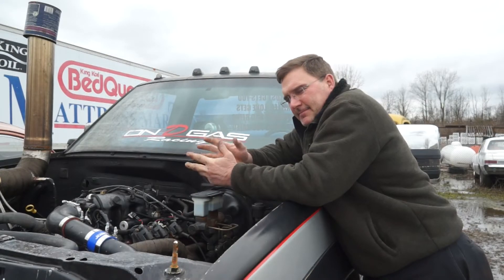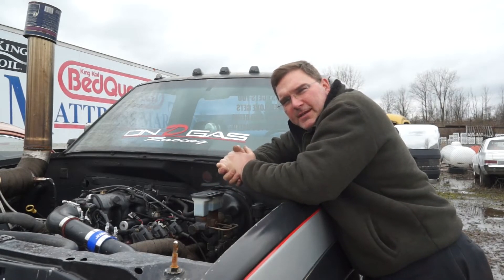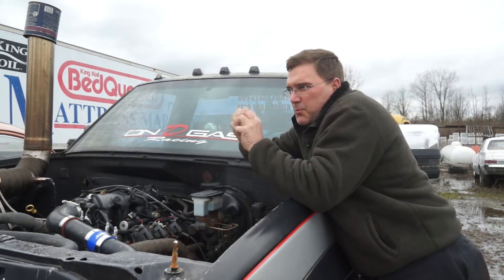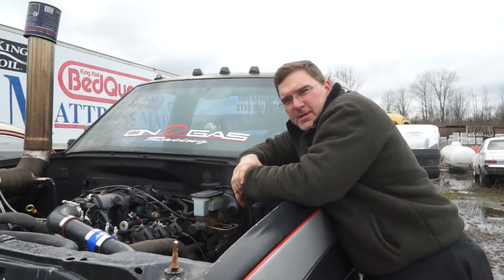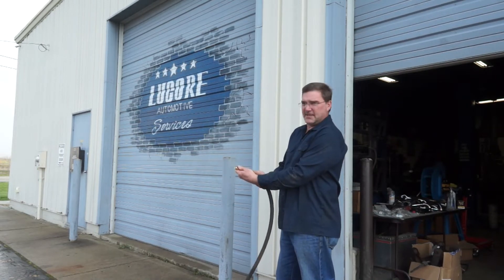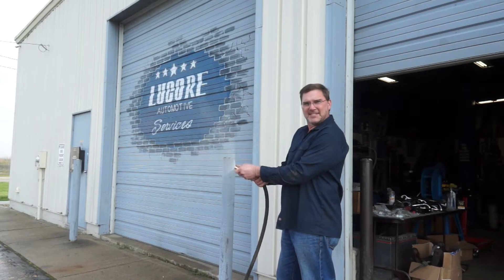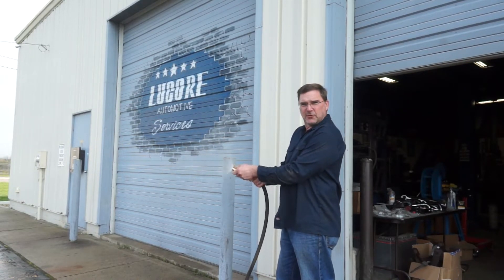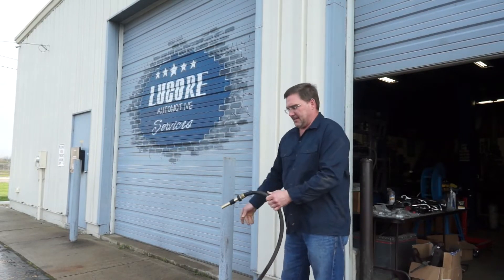It had uncapped fuel injectors in it. Uncapped fuel injectors are a great way to get more fuel into your engine, but instead of having a spray pattern, they're just more like a bucket of water being dumped into your cylinders. Every time your fuel injector fires, it sprays a pattern of fuel. This is good because it atomizes your fuel and it's a regulated amount of fuel that's being passed into the cylinder.